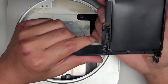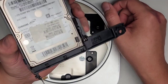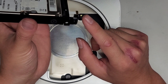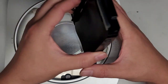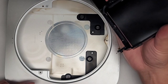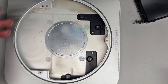You can put any size you want in there — if you want, you can get a 4TB. They have 4TB SSDs. The back here has these little metal tabs, so be very careful with that. I believe this is the hard drive indicator light or activity light — that little cable runs along here. If this breaks, the computer will still work okay. But that is the hard drive activity light that shows on the front, and it also shows if the computer is in sleep mode.